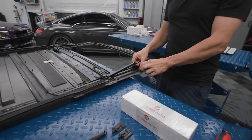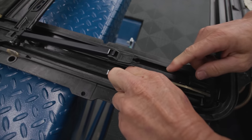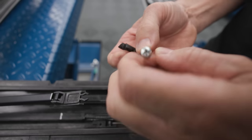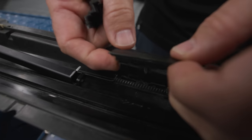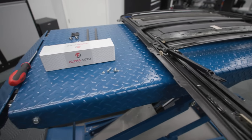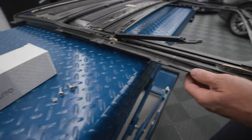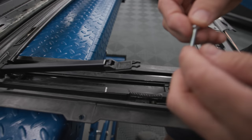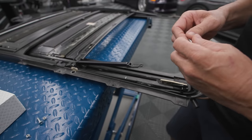What we found was this is how you get it apart essentially. Someone put a sheet metal screw in and it stripped out, and this was cockeyed, which was causing everything to bind. This is not the factory screw - the factory screw is a Torx head, and this one's actually stripped out too. So what I'm going to do is through-screw them with five millimeter screws and nylock nuts on the back side. Then I'll trim the back side of the screw off with a grinder so it'll be nice and flush.